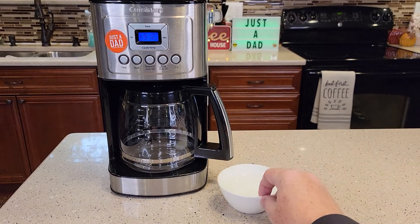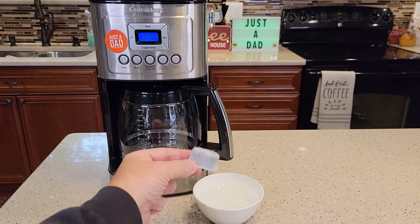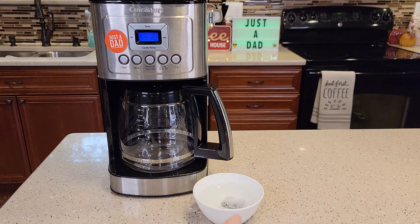Get a cup of water and place the new filter in the cup of water. Let it soak for 15 minutes. Your water is going to turn like a gray — that means the carbon dust is coming off of that carbon filter on the inside. That's a good thing.